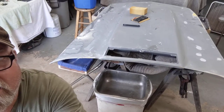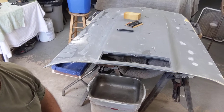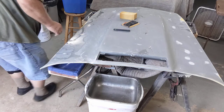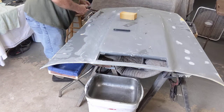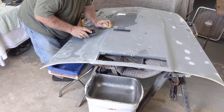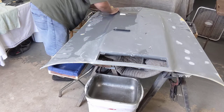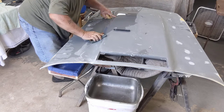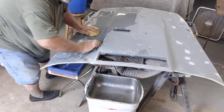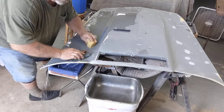We're now at the 1500 grit stage. Hope you can see that fine without zooming in too close, but we're on the 1500 grit sandpaper wet sanding today. I really didn't need the setback, but with these fiberglass hoods, you've got to be careful with these reveals so that we don't blemish or move back too far. We're going to do some wet sanding. The catch pans are working great.